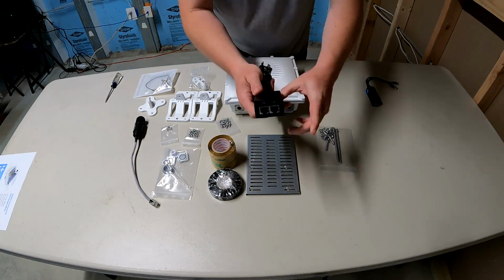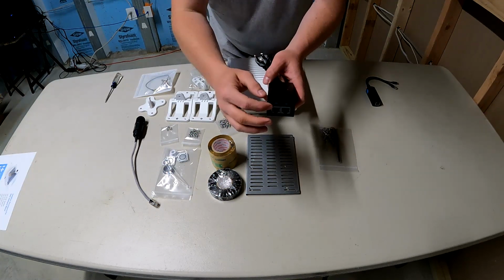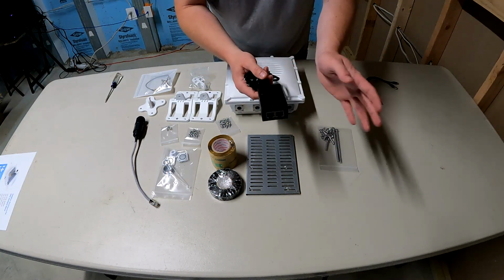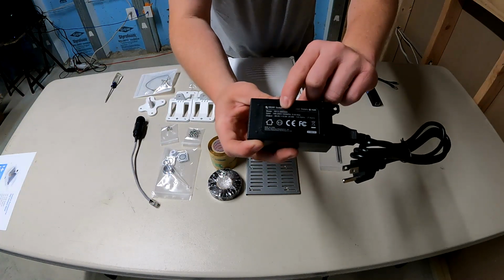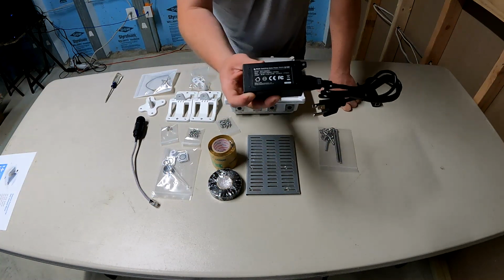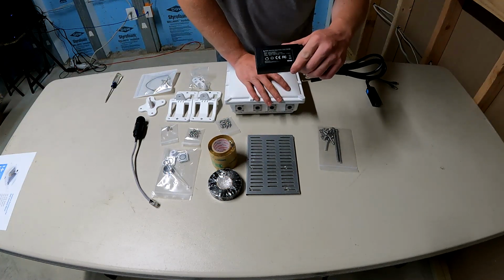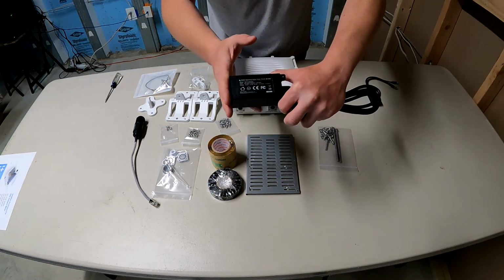So I'm going to hook this to my router, and then my line that runs outside, all the way up by the antenna and then back down into the enclosure, will get plugged in here. So this will be the house side. This goes out. Now the one that comes with this is 48 volts. I don't know if you can see that, but it's 48 volts. That's more than sufficient to run something small the full 328 feet. The miner only draws 5 volts, about 3 amps. So that's what puts the power into the line.